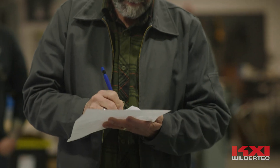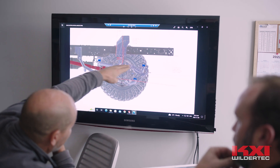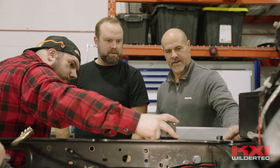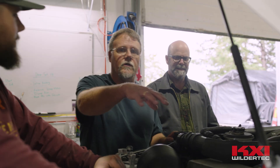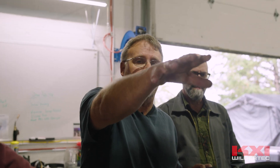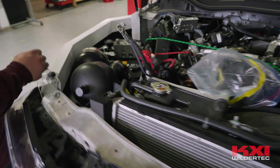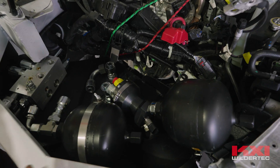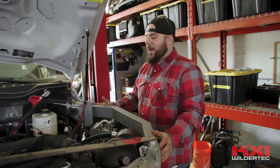This will basically be the big milestone in having all the hydraulics mostly finished up, 100% mounted where things will go. This is probably one of the larger components that really make this vehicle what it is. Everything in the front is all exactly the same as what's in the back — the only difference is it's a little tighter here so we had to change the mounting orientation. So we had to cut out this whole structure, plate it for strength, and widen it out again.